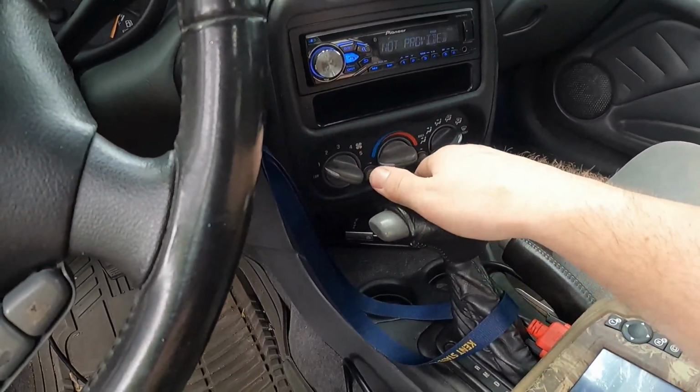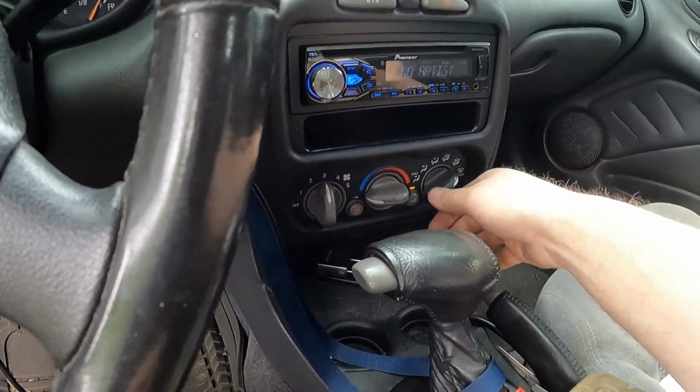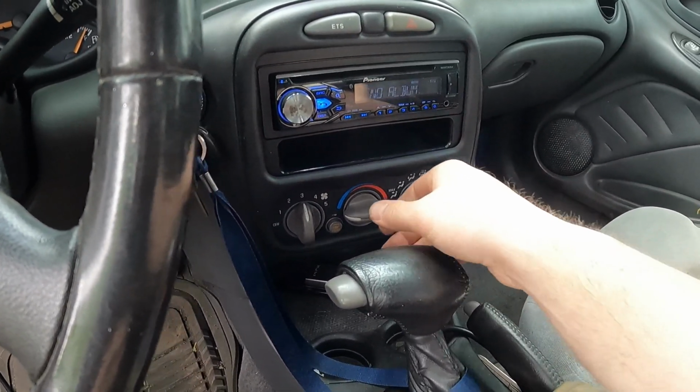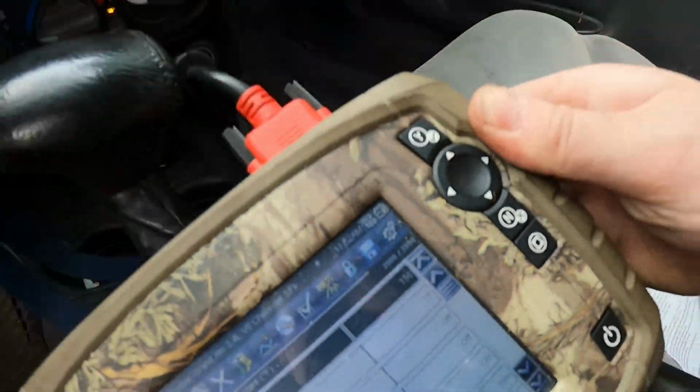So what's supposed to happen is I'm gonna go ahead and kick the AC on. Okay. So the compressor just kicked. It is showing off. Now, I'd have to look in the tune. I don't remember, but there may actually be a pressure threshold within the AC system that will trip that fan. But as you can see, the PCM isn't even commanding it. So the fan's not bad, it's just that it doesn't need it right now.